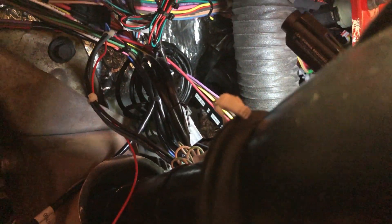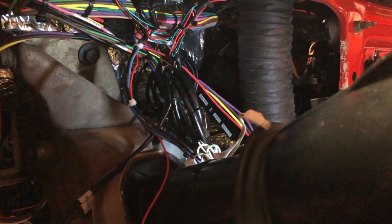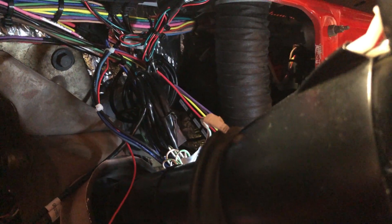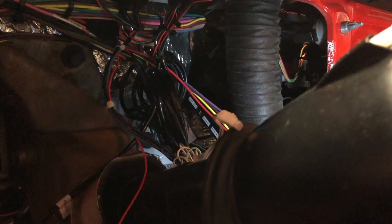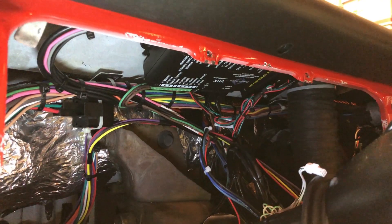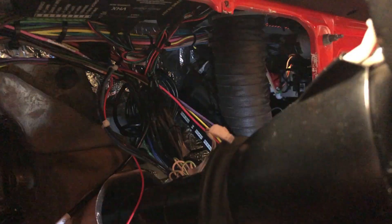I'm running out of space, which is crazy. I'm planning to put Vintage Air on the truck eventually, so I didn't want this taking up too much real estate out in the open. I'm going to mount the relays right on the side of the windshield wiper motor using heavy-duty velcro — the same way I mounted the Dakota Digital modules. You can see them back there with the white labels.